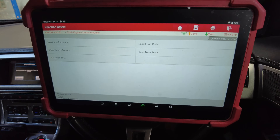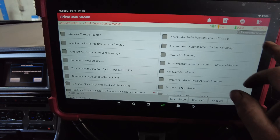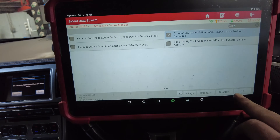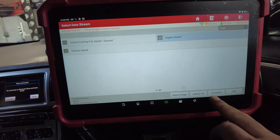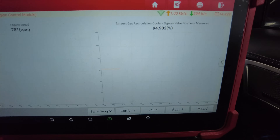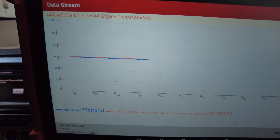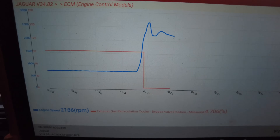After a successful test drive of about 20 minutes, I'm going to jump on now and read the full codes - we've got no DTCs. What we're going to do is have a little look at some live data. We've got EGR bypass valve position measured and also engine speed, just to show you in a graph. The left one is your engine speed and the right one is the bypass flap opening and closing. You will see it opening and closing as I raise and lower the revs.